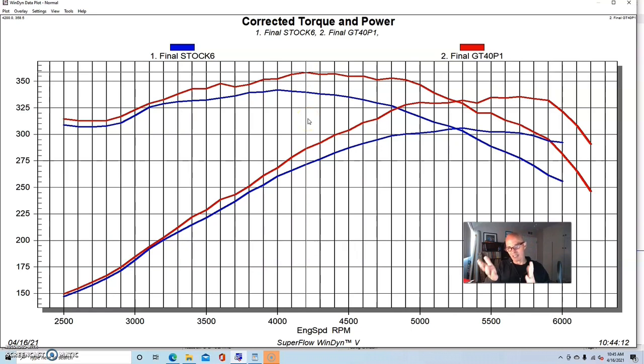The results are a little uneven, so I think you could get even better gains. If you were to run this with a 274 cam with even more camshaft, the gains would be even greater — we've seen around 40 horsepower from either a GT40 or GT40P head. The great thing is you can also port these heads and make even more power. I'll show you what happens next when we add a cylinder head that flows even more than the GT40.